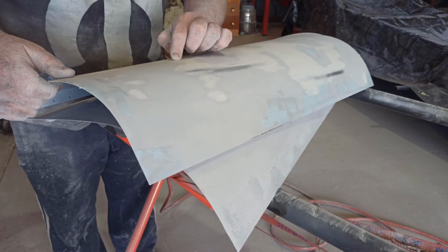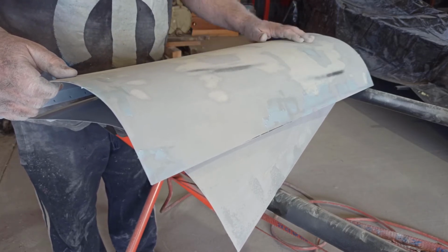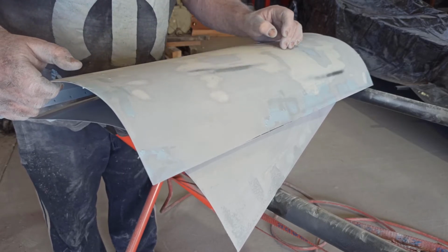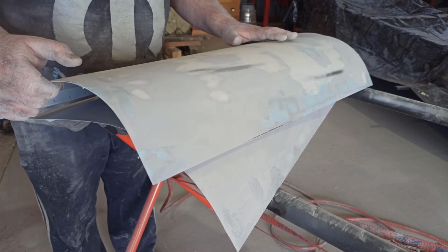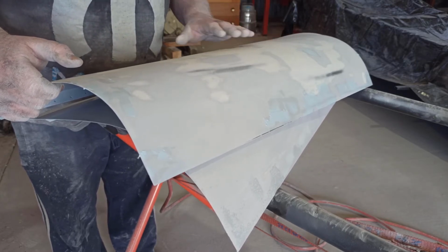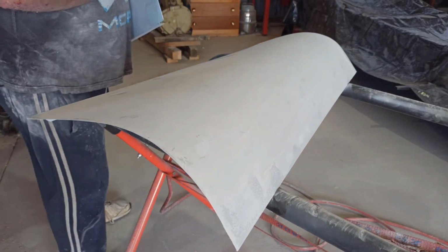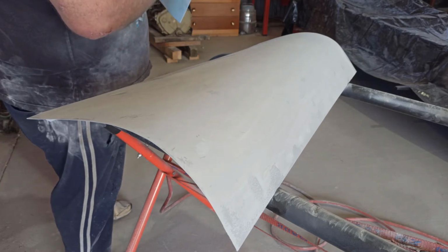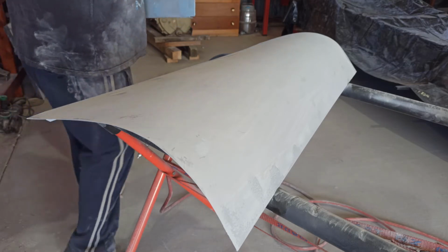But if you've got a big patch in it like this, it's bare steel, and another big patch over it like bare steel, you've taken too much off. You just want little pieces here and there, which is not going to hurt at this stage. But you want to try and get this, your high build, and obviously your body filler underneath, because like you can see the body filler that's on that, I'll block back. I'll put some glazing putty in the worst holes. I'll hit this again shortly.